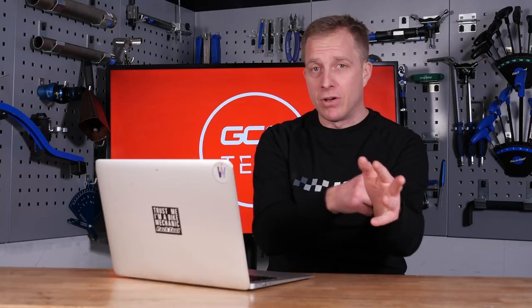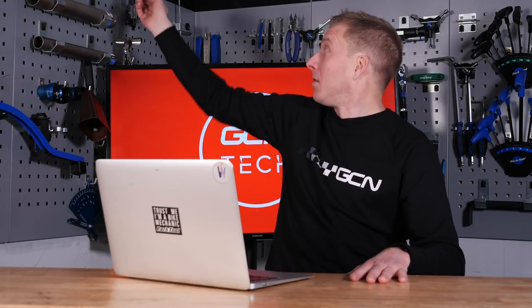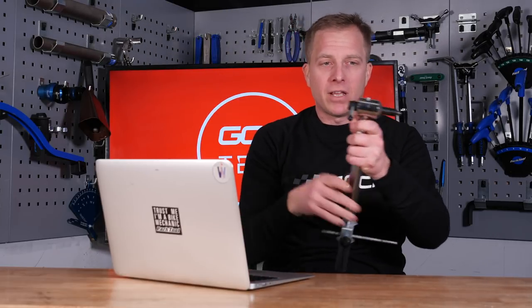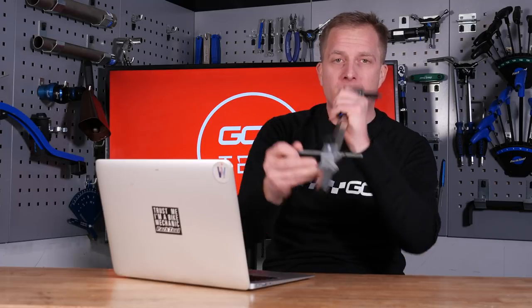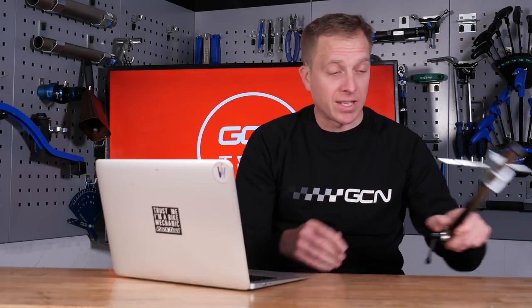Next up, we've got xdjoebikes99, who says: Hi John, I've got a Voodoo Limba cyclocross bike and it seems to skip gears a lot. I've crashed it a lot, so I don't know if that has anything to do with it. Yeah, I reckon it probably has. It sounds like your rear derailleur hanger is probably slightly bent inwards from one of those crashes, making the derailleur not sit quite in place underneath the cassette. That'd be my first port of call — pop down to the local bike shop and get them to have a look. They've got a derailleur alignment gauge — here's one I prepared earlier. This bit threads into the derailleur hanger, and this gauge you line up at different stages around the rim to check how in line it is. Failing that, it could be that your chain's worn, your cassette's worn, or your cables are grotty and need replacing — but try it in that order and hopefully you'll have skip-free gears in future.